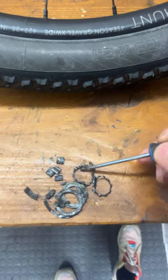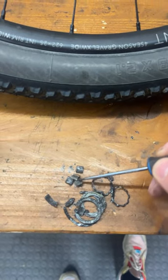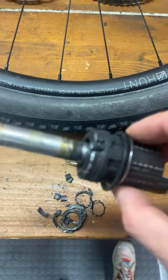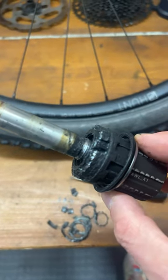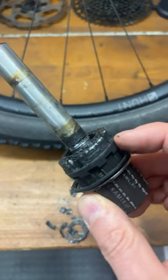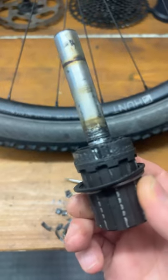What we're looking at here is what's left of that collapsed bearing, and these are the little pawls. The impact is that the collapsed bearing has completely eaten into the axle — that axle is about to snap. All the pawl springs have disintegrated. It's not looking pretty.